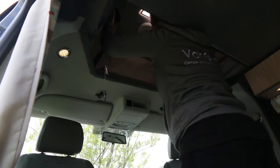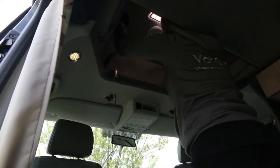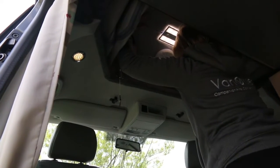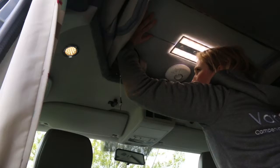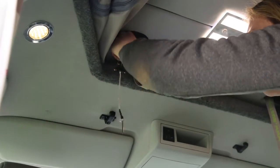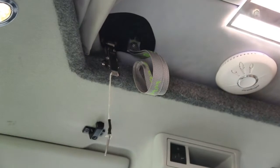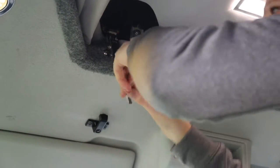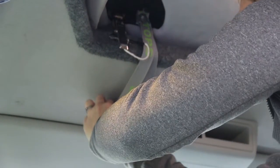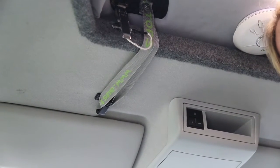It's imperative that the canvas stays away from the clips. Make sure it's nice and tidy at the back, then ensure the clips are lined up with the hooks at the top. You can pull the roof from one side to the other, and use your hand to keep the canvas away. Making sure there's no canvas in the way, hook the clips back on, pop the safety pins in, and attach the loops around the hooks.